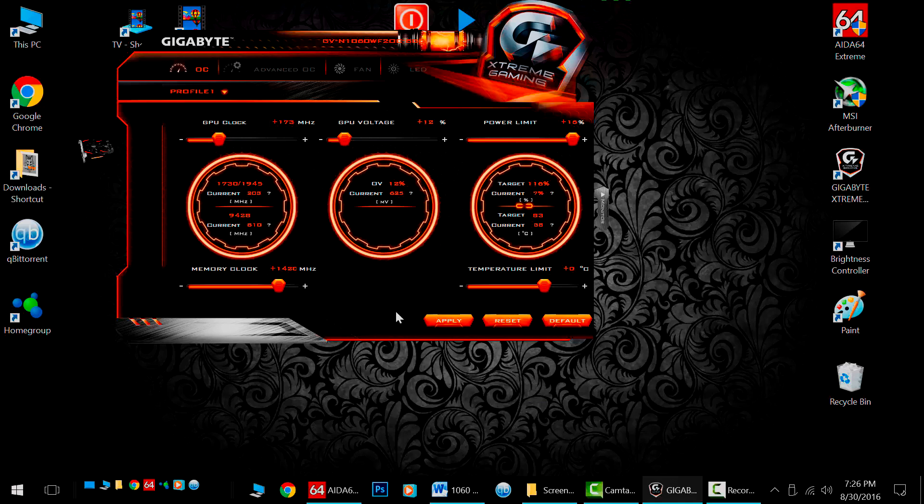Back to overclocking. As soon as you touch anything on this page, we'll immediately go into manual overclocking mode. So let's go over my overclock. I've got a very high memory clock — be cautious. I started at 600, went to 1200, eventually tried 1500 which I found a little unstable, and found a good decently stable run at 1420. This was the number that worked for me — results may vary.